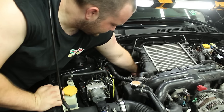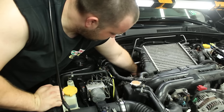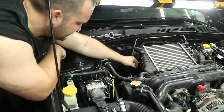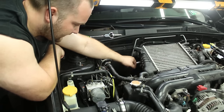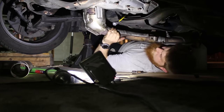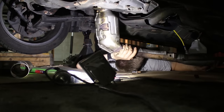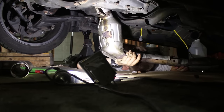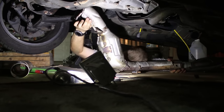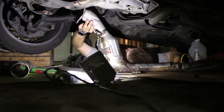We're getting our nut off. Do you have your glove on like you're supposed to? No glove. But I did get the nut off. Now, with all five downpipe bolts out, we can go down, disconnect the oxygen sensor, take the other two bolts out, and this baby's dropping. Just let it drop down. My issue was that I was under it — I dropped it on my chest. I ended up having to inchworm out of the front.